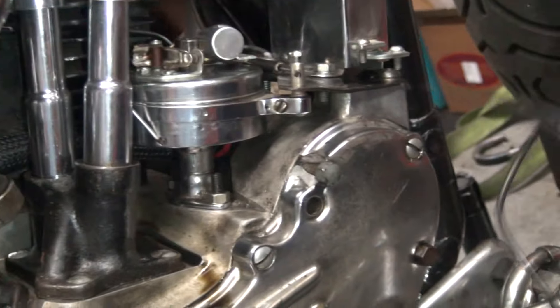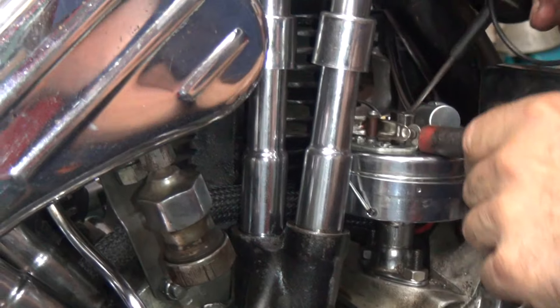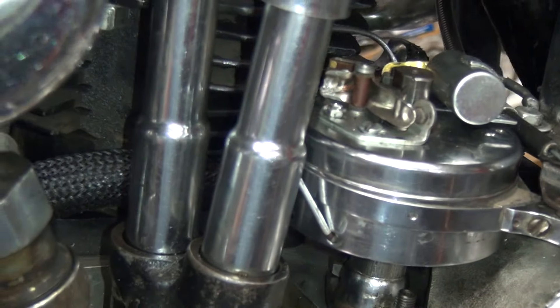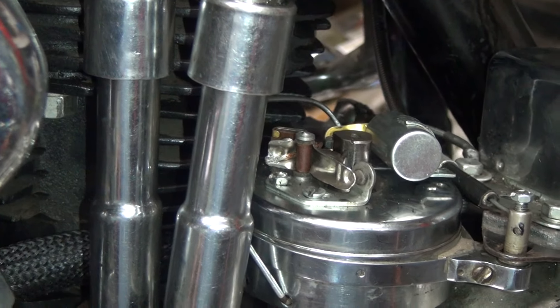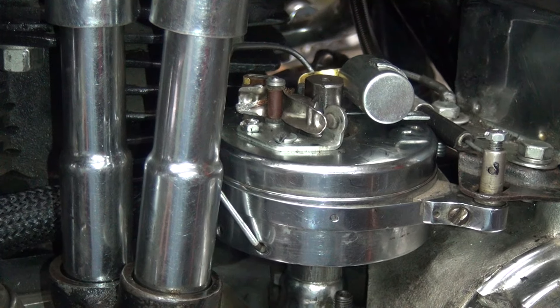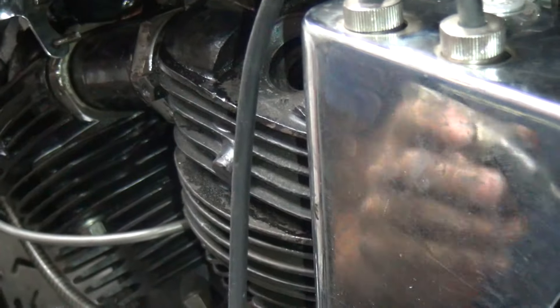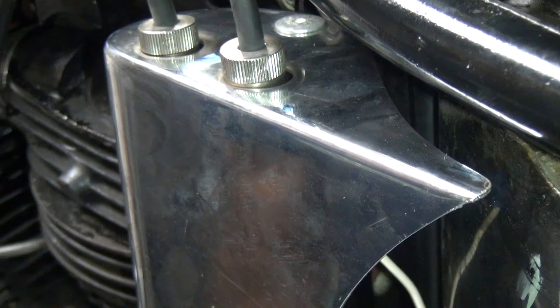You want to try and check it again? Probably still won't have any juice. You'll get no juice when that falls off either. Yeah, that's grounded. Could be enough power from the coil — do you have any coil shot? We've got power on that side of the coil. So the coil's no good — we're not getting any power through the coil. Your coil's got an open circuit in there, so it's no good. Little junk-o. Junk. Alright, let's go ahead and you can pull this off and we'll come back when you get it swapped out.